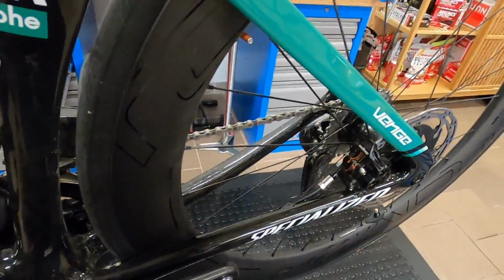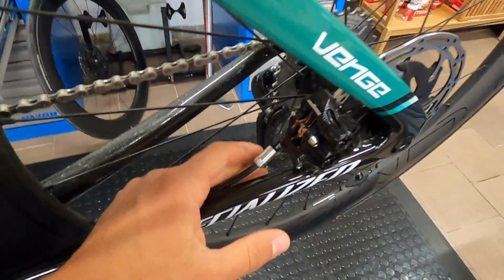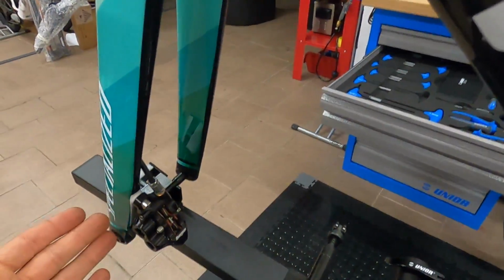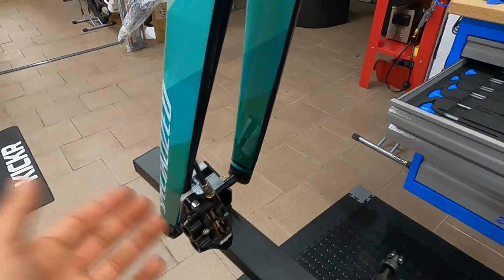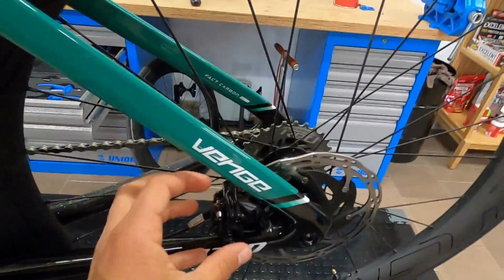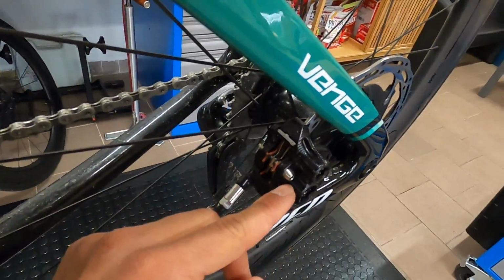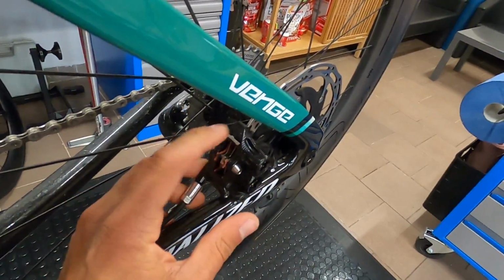but anyway, I have managed to install this. Otherwise the installation is pretty straightforward. Bleeding was very easy with the front brake, because then you just stick to the recommendations in the Hope manual and it's good to go. But the problem arises if you try to bleed the rear brake. It's positioned differently, and the Hope caliper is a lot more complicated, having 4 pistons, so it's not so easy to clear out the air from it.